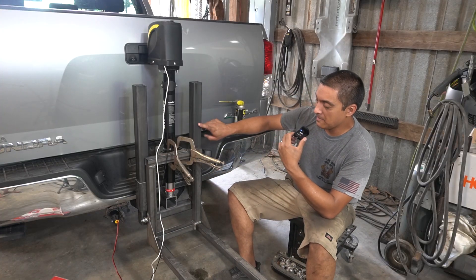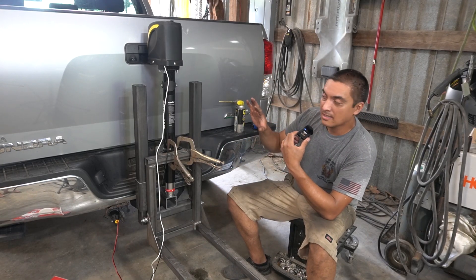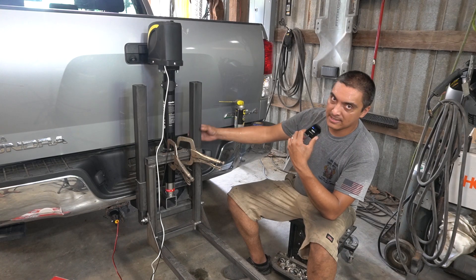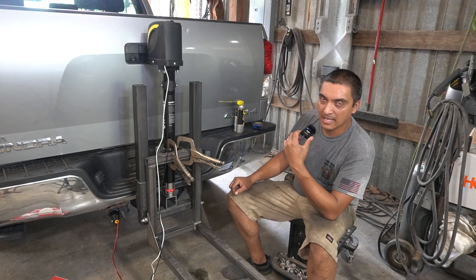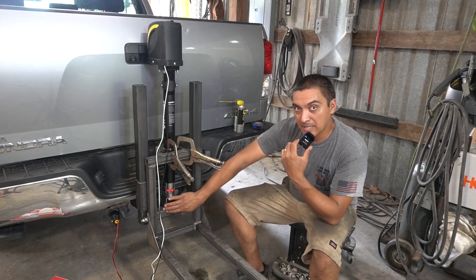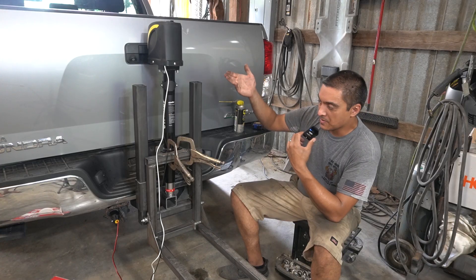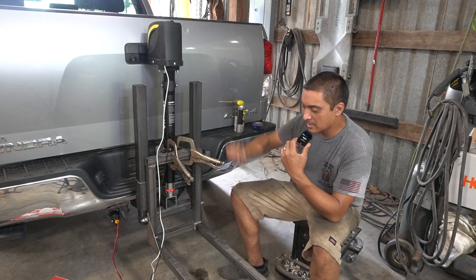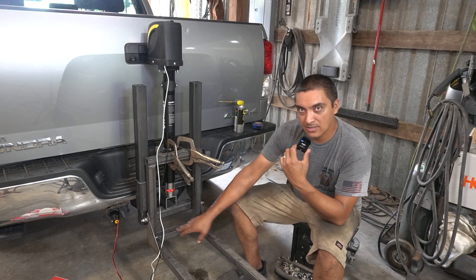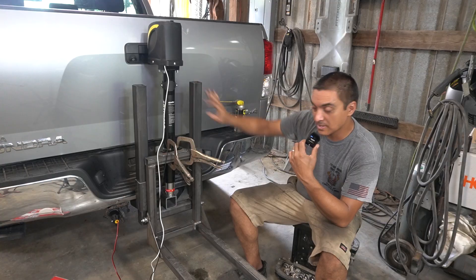I got the bearings installed as rollers on the frame and that seems to have done the trick — we can put a bunch of weight out here, lift it up, lower it, and it lowers smoothly with no binding. I do have another set of bearings so I can add them on the back side if needed, but I'm trying to avoid that if I can get away with one set. Also, there's a piece of two inch receiver here: when the carrier is all the way up in the highway position, I don't want all the weight of two motorcycles pulling on this framework, so I'm going to slide a piece of steel tubing through there to take the load off the jack and the arms.